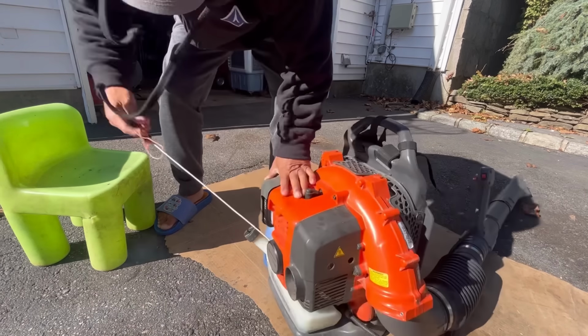That is trashed. Yeah, I can clearly feel it, especially over here at the top. Really deep. And as you can see, only a portion of the top ring is sticking out. Actually, it looks broken. Yeah, ring's broken. See how uneven the break is? Unless that's where the hole was, see? Yeah, you got a busted ring and a badly scored piston.